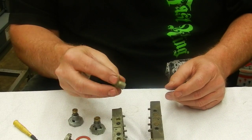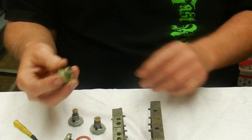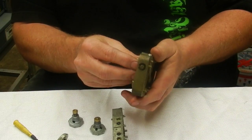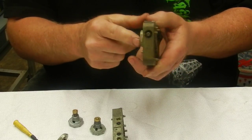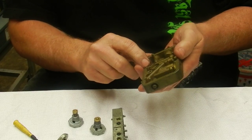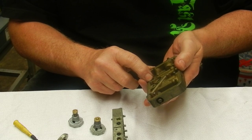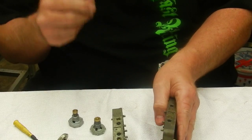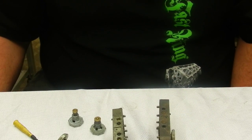One other thing: here's a block-off plate. If you're not going to use a power valve in the rear meter block, you just use a block-off with a gasket, stick it in there, tighten it down, and then you jet up about six to eight jet sizes and you'll be good. You might have to play with it a little bit, but six to eight sizes up on the jet is usually real close.